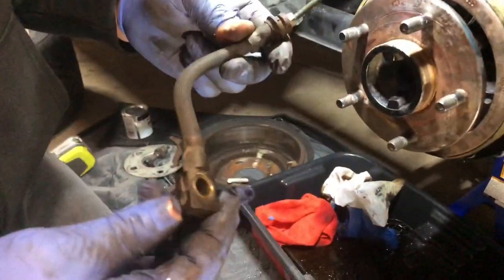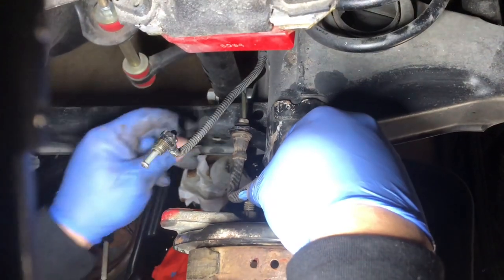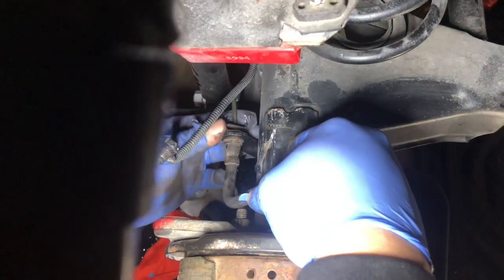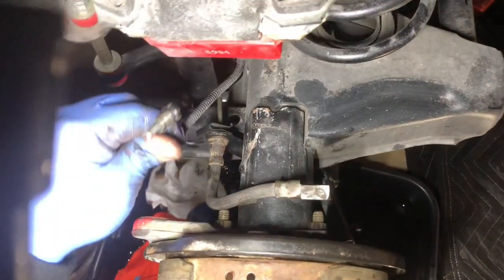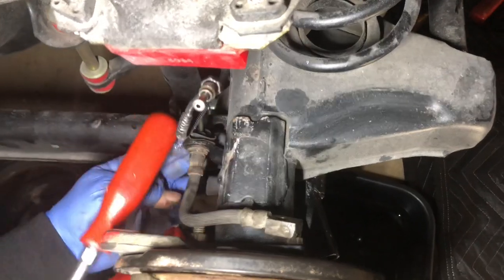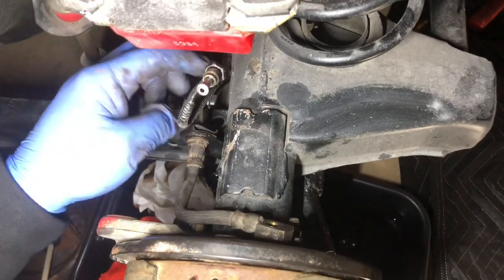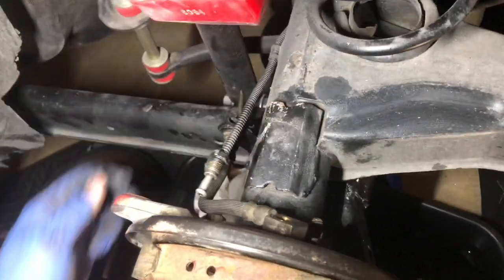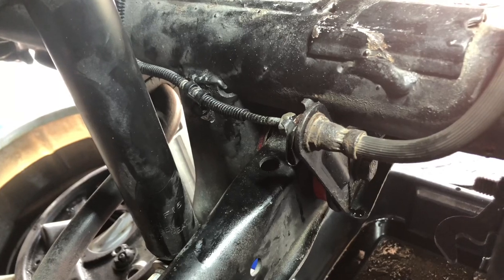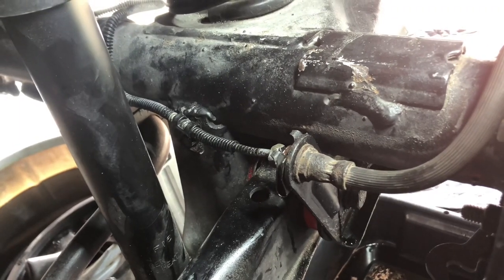This is the brake line we're going to install. It goes into the bracket that I just installed in front. And if you did like I told you and grabbed a clip, it just goes on there like that. That's in - that's not going anywhere. Now we need to make the brake lines connect together. That's the brake line connected to the existing brake line that was already there. All I had to do was cut that, slide the fitting back on, and re-bubble it.